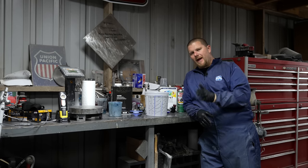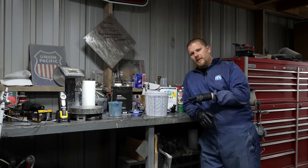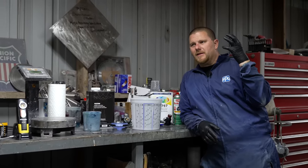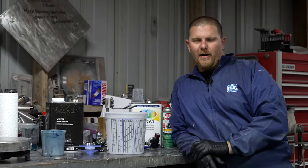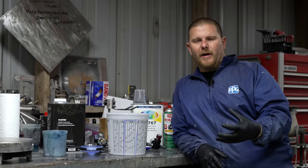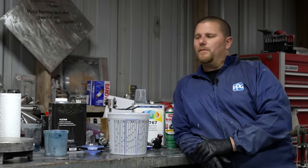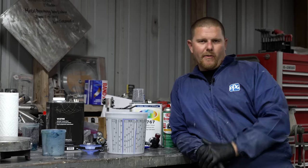And the reason that we do those back to back is because if you were to do, call it 3, let it dry, sand it, and then re-clear it and do another 3 coats, people have this mentality, the stigma, where they say, I've got six coats of clear on that car, and that's the protection that I need, or that deep look. If you're looking for the deep look, I can assure you it is not in the clear. Does the clear help? Yeah. But what's actually giving you the depth in your paint job is your body work.